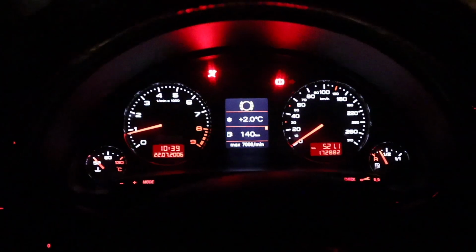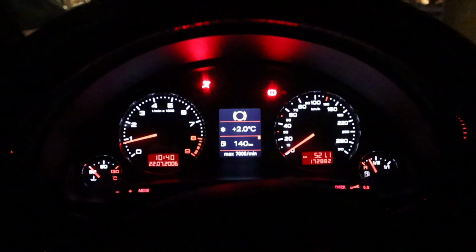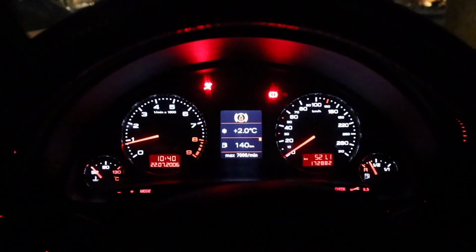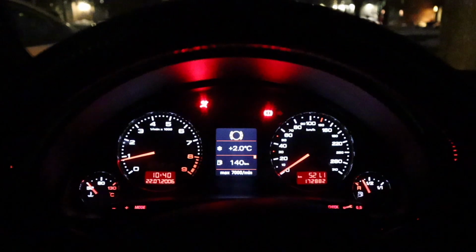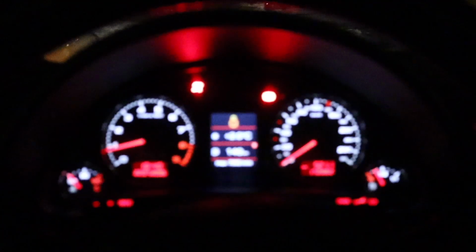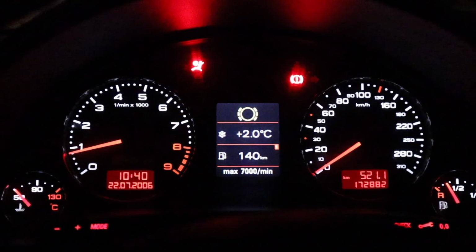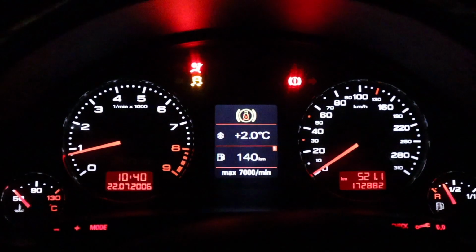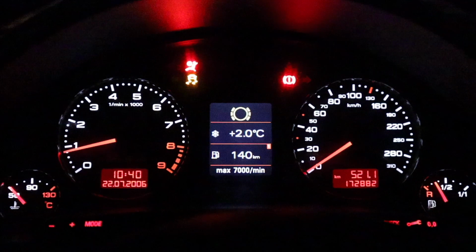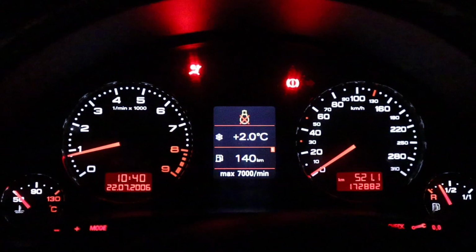Believe it or not, guys, just pulling the car here, let me turn that display on. Believe it or not, just pulling the car out of the garage turned the traction control light off by itself. Now, that was really interesting. The car only needed to move 15 meters there. Come on, focus, don't ruin my video. So let's try the ESP button now. Okay, there it is, flashing. That is a correct thing, to push it once and have it flashing. That's half traction off. Now, let's see if it turns off. Perfect. Turned off with a click of the button.